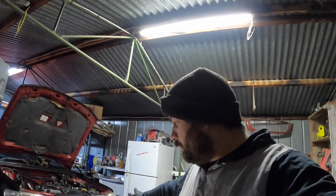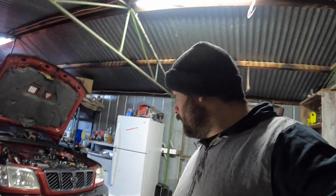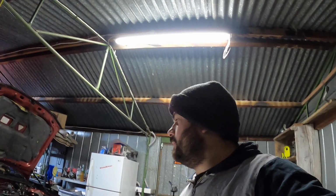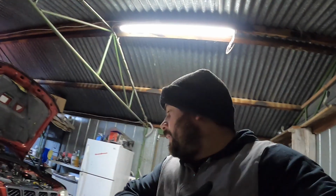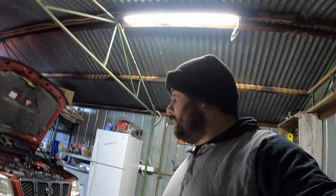Anyway, I got the manifold and up pipe all bolted up. It tucks up so much higher than that one over there. So it's good. Lowest point now is the front mount cooler, which is annoying. I guess I could try to raise that up for better ground clearance.